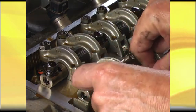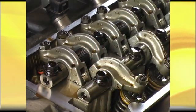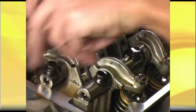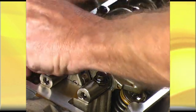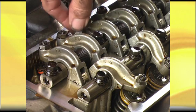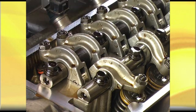I'm happy with that one — it's got a nice drag on it, so I'm not going to bother adjusting the exhaust. Let's see what the inlets are like. That one's not too bad. They've got a decent drag on them, so I don't have to set the number four cylinder. If we're not going to set it, we'll carry on to another cylinder.